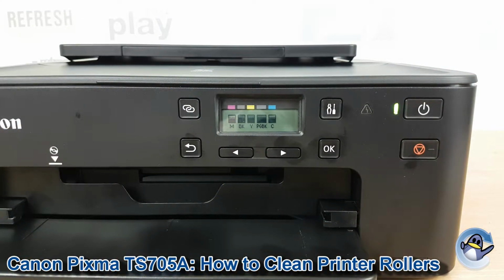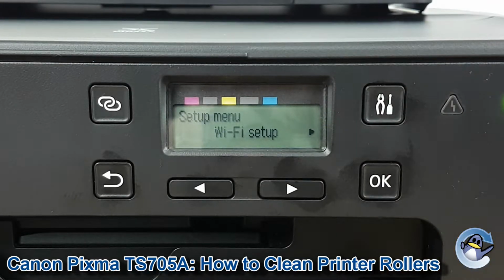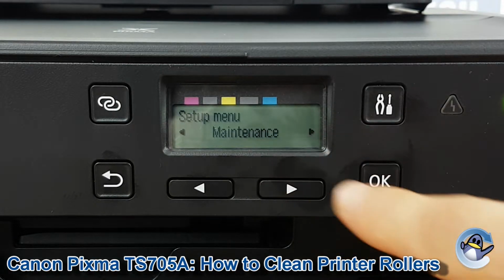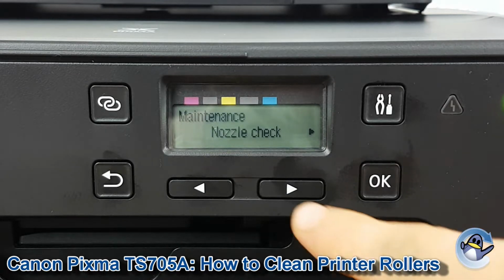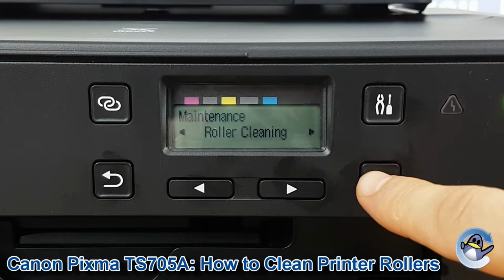Now to start the cleaning, we need to go into the setup menu, which we do by pressing this button here, marked with the pliers and a screwdriver. Then we use the right arrow to get along to maintenance, and then press OK. We navigate through until we get to roller cleaning. Press OK.